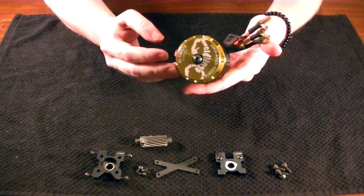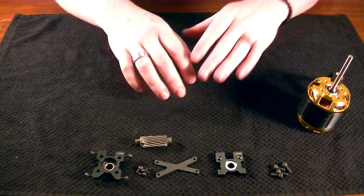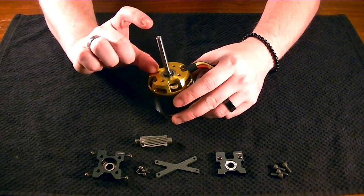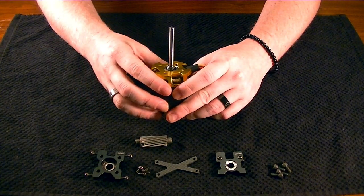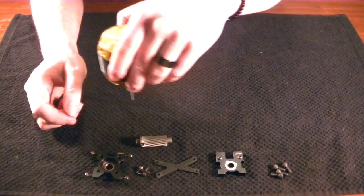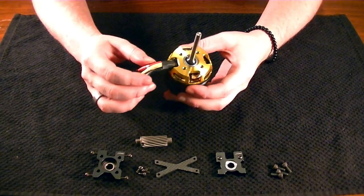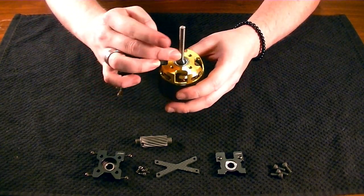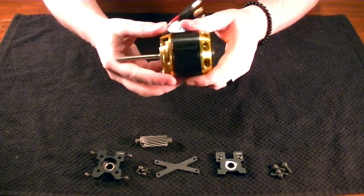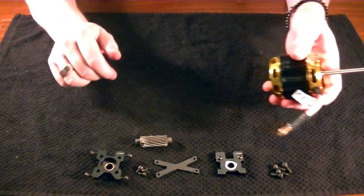Now for this video, I'm going to be using a Scorpion motor, of course. I've got all the parts lined out in front of me. So essentially what we're going to be doing is installing what I'd like to consider a pinion cage around this with a support bracket. That's just going to be a plug and play — it fits right in, you adjust your motor mesh and everything. But there are a couple of important steps to address along the way to make sure you get a true running motor shaft, no stresses, and avoid things like high frequency vibrations.